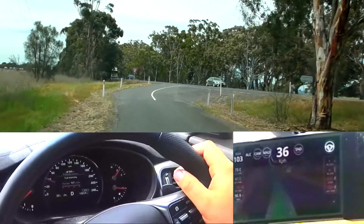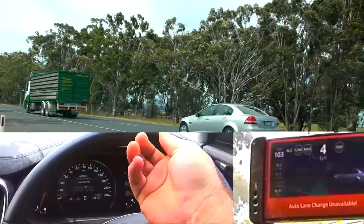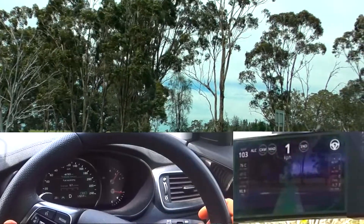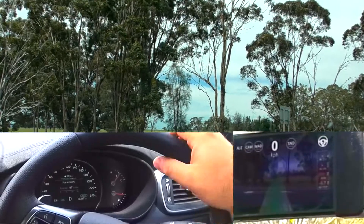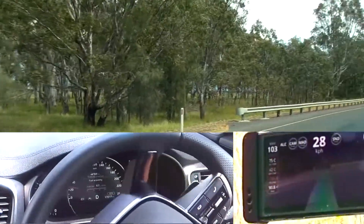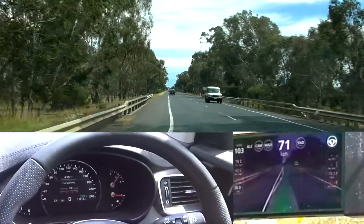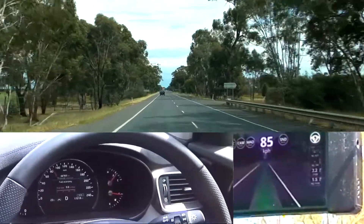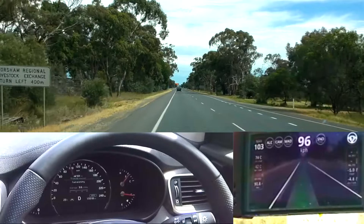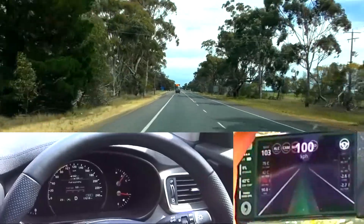This is something to do with the way that Kia have programmed the MDPS - the faster you go the stronger and stronger the steering assistance becomes. Auto lane change is not available now. You can see that I'm using the brake, I'm using the accelerator, cruise control is not enabled, but OpenPilot is still running. Let go - you see OpenPilot still in control, lane departure on. Enable cruise control - all fine.